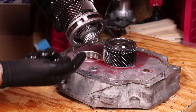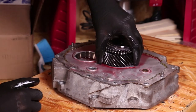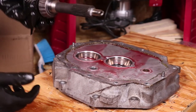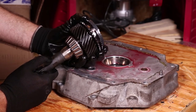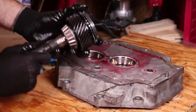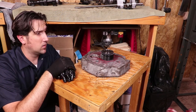The input shaft should lift right out from here. The bearing race looks good enough, and the synchronizer ring and gear don't look too bad. Gears are pretty hard metal, so they're pretty hard to tear up. Let's point the camera at the bench and take a look at the main shaft, the synchros, the gears, and see what it looks like. So far it's better than I expected.